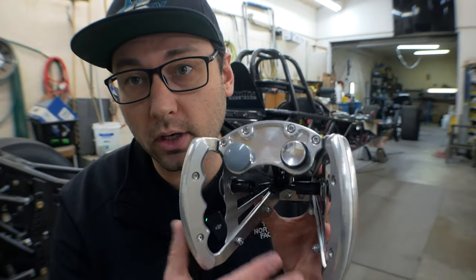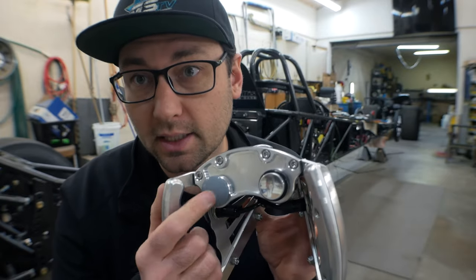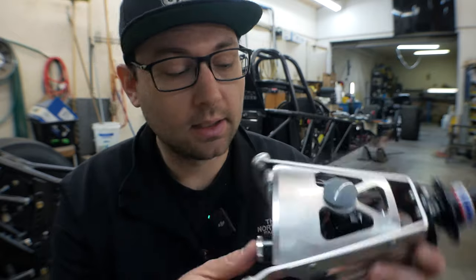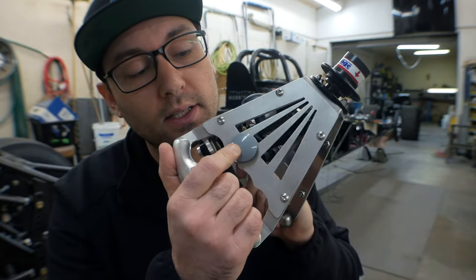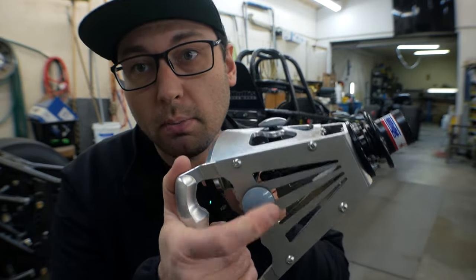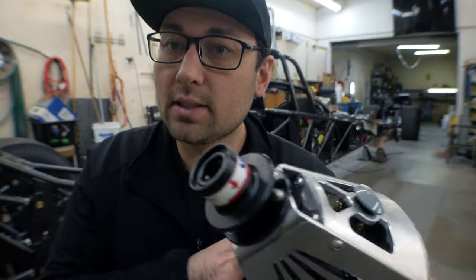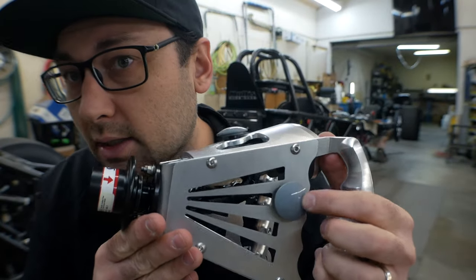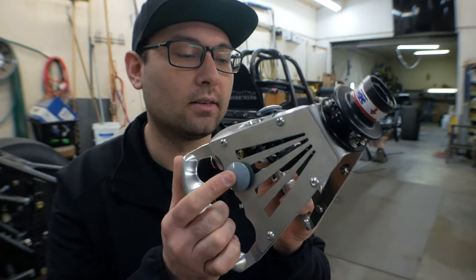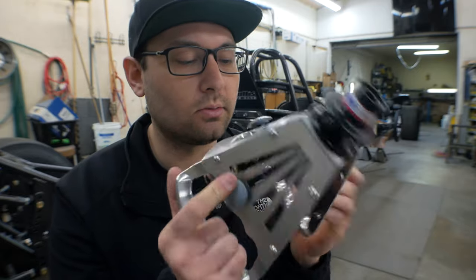In case you're curious what all these buttons are: obviously I have my trans brake button, my bump down button, as well as engaging my Pro Stage starting line enhancer. Up on top is the bump up button. Over here on my right index finger is just a two-step for doing burnouts — I like to have my hands on the steering wheel while I'm doing a burnout and be able to hold down that button easily. And then on the opposite side, in a similar situation, down track, if I want to engage nitrous I have that on a button so I can keep my hands on the steering wheel while using those two buttons while the car is in motion.